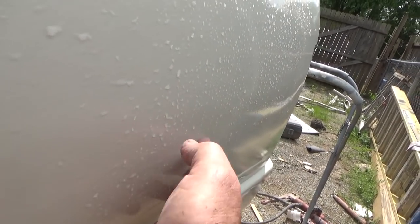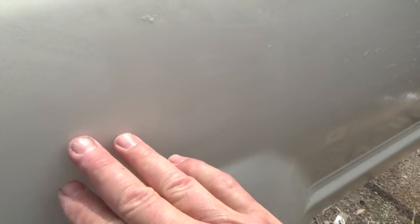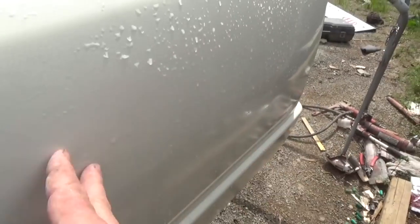This is the orange peel — you can see it, it's kind of a rough, orangey finish right here on the edge. As it gets sanded down you can see it here, and then it's not here at all, then it's gone. This is where we're trying to get to: just a super smooth, flat paint finish — get all of that out of it.